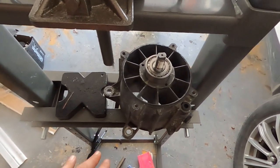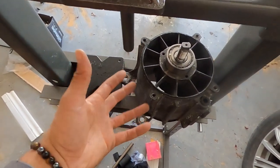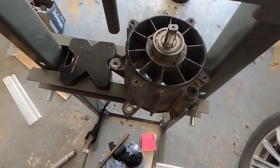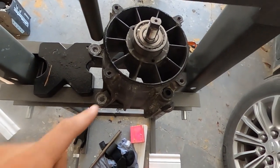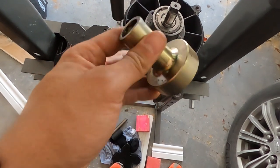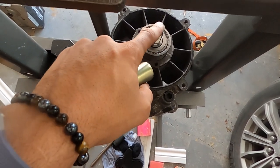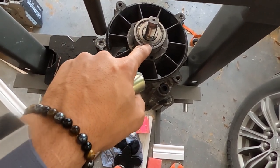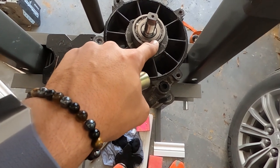And then we can go ahead and set up our press. I still have my wear ring in there, so I need to put the plates in a position where it supports the pump but doesn't smash my wear ring, because as you know, the neoprene seal and a part of the wear ring stick outside of the pump. I'm not sure if I said it before, but when you are pressing your bearings, you always want to put whatever you're using as your contact on whatever needs to be pressed. So when I was pressing the bearing onto the shaft, you want to press on the inner race. And now that I'm pressing the bearing and the shaft into the pump, since this outer ring, which would also be considered a race, is being pressed into the pump, I'm going to want to apply pressure to that.